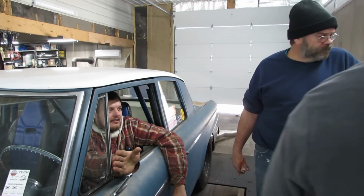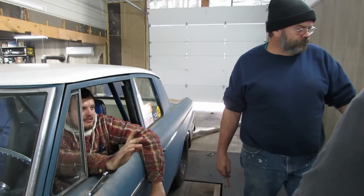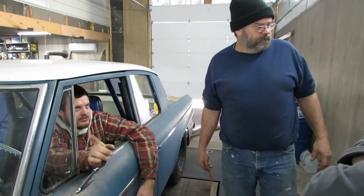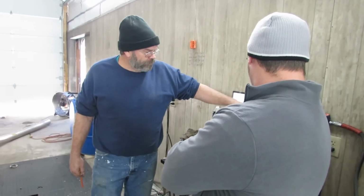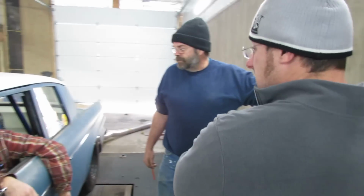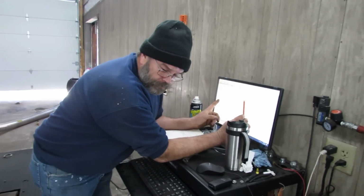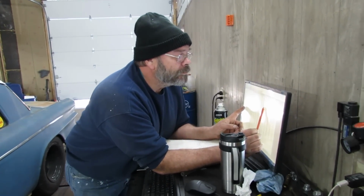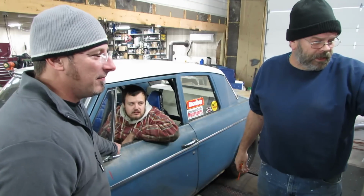It couldn't work at all, too far off, and it was basically returning that it was at 0 position, which makes the controller say, okay, give it all of the duty so that it changes to the position you want. Look what never happened before. This curve was always a plateau. Yeah, absolutely. It likes all the angle up top. It definitely does. Whatever happened on run 6, it didn't like on the bottom end. It was giving it all the angle, the whole pull. Okay, that explains it.